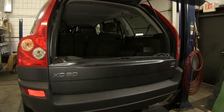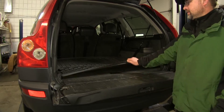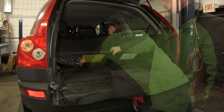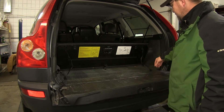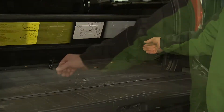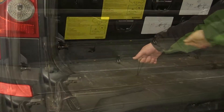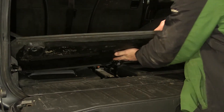To begin our install, we're first going to open up the rear hatch and tailgate. We're then going to remove the rear cargo cover, open up the rear panel, and remove it. To remove it, we'll undo the strap on each side, which is just a simple metal button. Once we unhook those two, we'll take the center cord, pulling up on it, and we can remove the whole rear section.